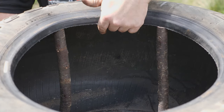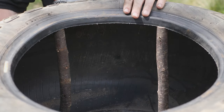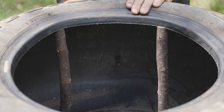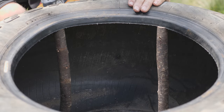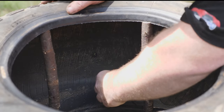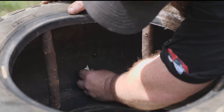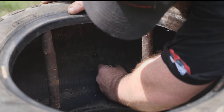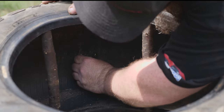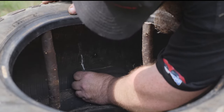Now we'll put the two spreaders in there so we've got decent access. Because there was a plug in there, I'm just going to run a drill bit through to make sure all the plug material is gone - the temporary repair is gone and we're getting ready for the permanent repair. Next, aim for your target. Our hole is there, but we need to buff around it, giving yourself a generous area.